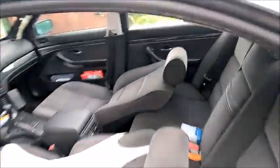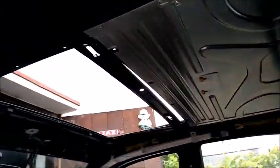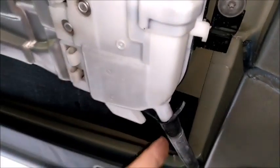Okay, after I took the headliner out, now the cassette is ready to be removed. And if it needs to be fixed outside, you can fix it outside. We're gonna remove all the holding screws around, and don't forget to be careful with the draining plugs. Take them out before you remove the cassette. You have 4 on 4 angles.